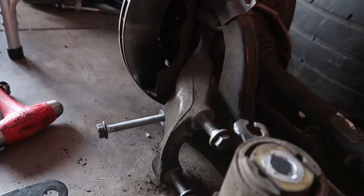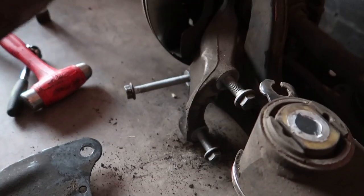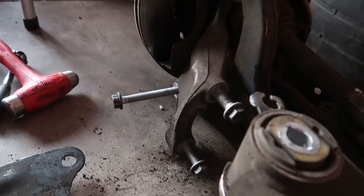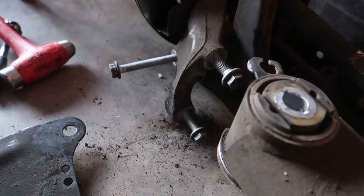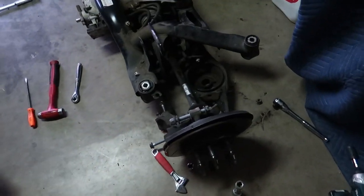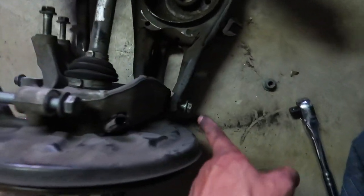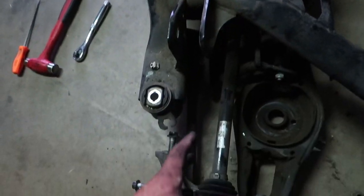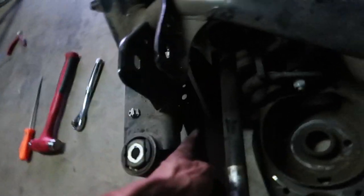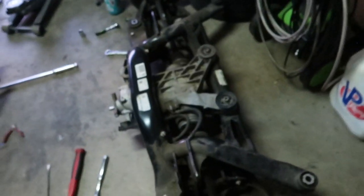The hubs will be the first thing I go to stick on, basically everything attaches to that. I'll get the axle on, then probably the control arm or something, and then start zipping everything together. A lot of this stuff is real tight and it's hot in the garage. I gotta record everything so everything's taking forever, but so far so good. Once I get this bolt out, this whole knuckle and brake assembly with the axle will slide out. Then I'm gonna get this other arm out, get the sway bar off, this arm, and then the same on the other side.